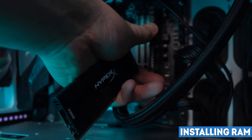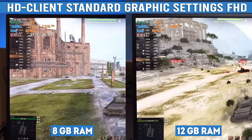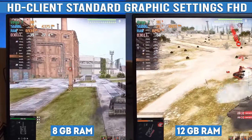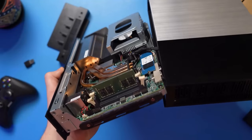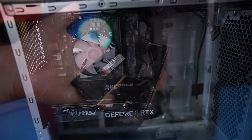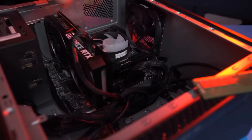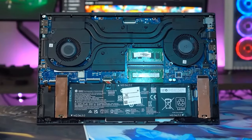Moving on, let's talk RAM. We're not going to talk much about dual channel, I'm positive everyone knows about it. This issue often concerns pre-built PCs and laptops where you can stumble upon a solution with 16GB of memory, but in just one module. Of course, in case you get such a machine, you can always buy a second RAM stick, but this is also extra money and not everyone needs 24 or 32GB of RAM, and on top of that, disassembling your device will most likely remove your warranty.